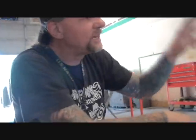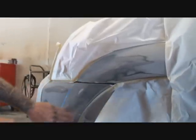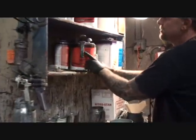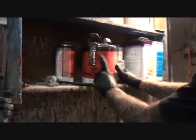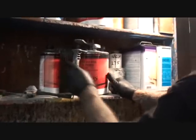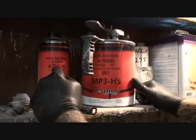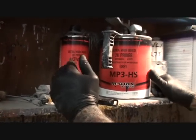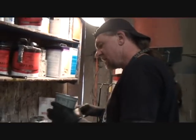I'm going to mix the primer up and prime it. I've got to put three full wet coats on this because this is a very rough texture, and we had to do it that rough just to get rid of all the damage. This little fix repair we've got going uses ultra-high build 2K primer. That's a 2K primer, which requires a hardener to activate the primer — it doesn't require any reducer, nothing.